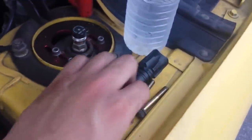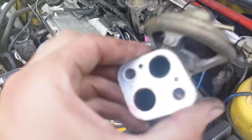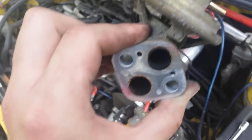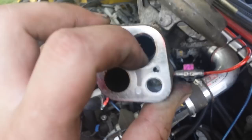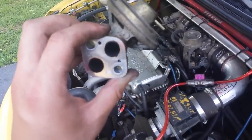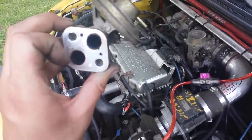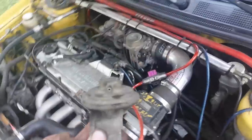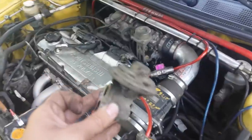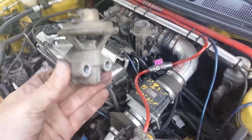Now we've got our two bolts out. This is the EGR valve — the vacuum line plugs right on the top. It has ports where exhaust goes in and out. We're going to clean those ports; there's some carbon buildup but it's not too bad. We'll use a wire brush, screwdrivers to scrape out the carbon, and then spray some carb cleaner in it. If you're replacing your EGR valve, this is where you'd just put the new valve on. If you have a code saying your EGR valve is bad, you can most likely just clean it first.